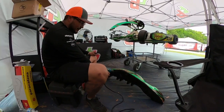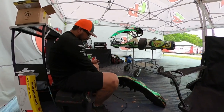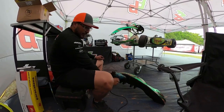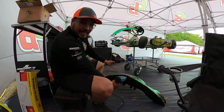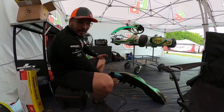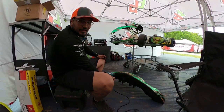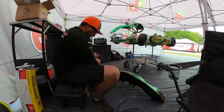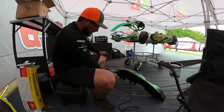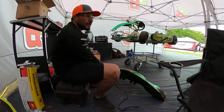First warm up out of the way. Ran really good, just half a second off. So we did a gear change, and the front bumper was dragging, so I'm heating it up and flattening it out. And then I gave him more brake pedals, so he has more brakes. Adjustment wise, other than that, nothing else for now. We're going to keep working, see how it goes this session. He was losing the front end because the bumper was lifting up the tires, so he was just washing his front end out.